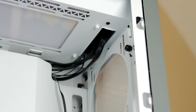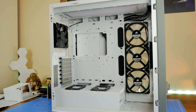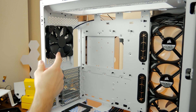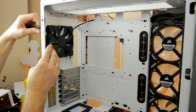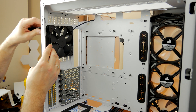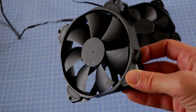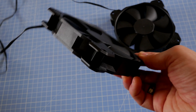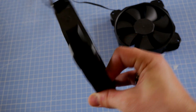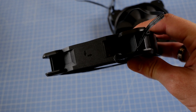After having all those other fans installed, I set about removing them all and reinstalling the original air guide fans. Here you can see the setup process where I took that rear fan off and the front one and set it up with ML120 Pro fans on the side and front, but then I wanted to experiment and test that. I've done separate videos on the original setup and also with a GPU mounted vertically. These air guide fans are said to be anti-vortex fans that have fins directing air in a concentrated flow to keep your case cool.